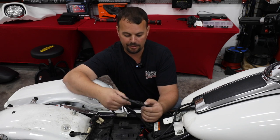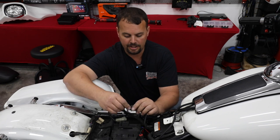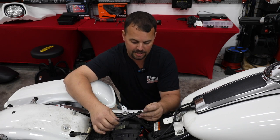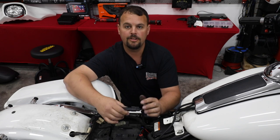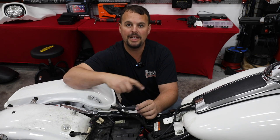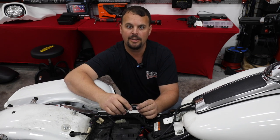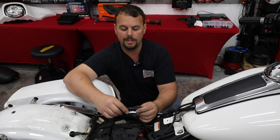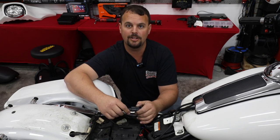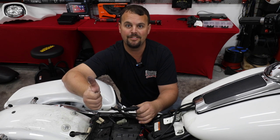So I wanted to point out this black connector and let you know that if you look, your wiring colors do not match up. And all you have to do is really undo this connector, unpin it, and move them to where they match up across the plug from each other. They call that putting a police bike in civilian mode. There are some documents at Harley that you don't have access to that tell you how to do it, but I'm gonna show you how to do it in our next video.